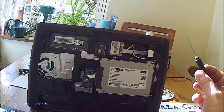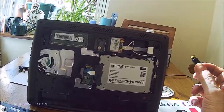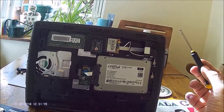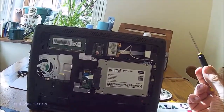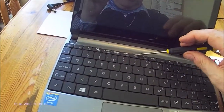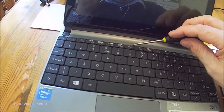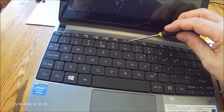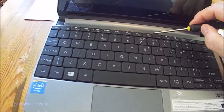That's about it. When you replace the screws, make sure you don't over-tighten them — remember they're going into plastic and just need to be tightened to when you feel a bite and then a fraction of a turn more. One other thing: when I was originally disconnecting the keyboard I managed to flick off a key. If you should do this, don't worry — it simply clicks back onto its base, as long as you put the right key back on the right slot.